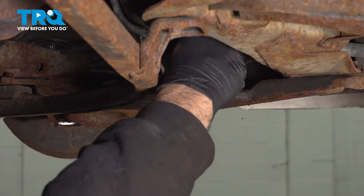We're ready for installation. Bring that filter up — when you tip it, you're going to lose a little bit of oil out of the side. Spin on that filter and give it a gentle, snug fit. Wipe down the filter to make sure it's not slick, then tighten it down by hand. An oil filter should not be tightened any more than hand tight, but it should be a good grip.